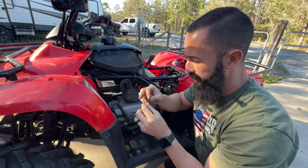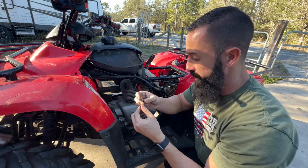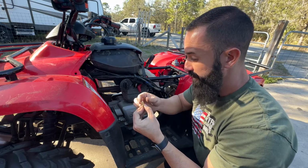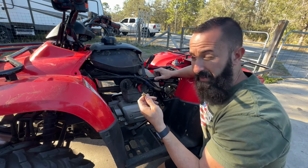So I'm just going to look it up on Partzilla and see exactly what sizes they're supposed to be from the factory. This bike is completely stock, so I should be able to put the stock jetting back in. I might bump the pilot up maybe 1, or not sure. Might just try to put the stock jetting back in it and just see how it runs. But yeah, that's the thing. I mean, that might not even help, right?